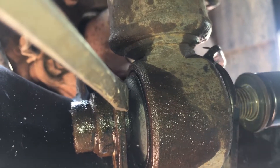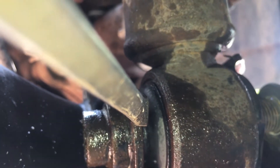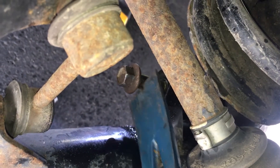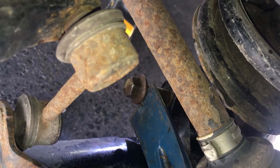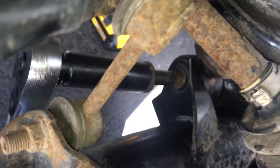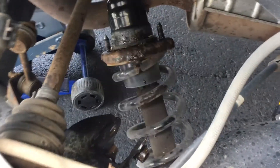Only try cutting this if you're unable to remove the screw in a normal fashion. As you can see on this side, I'm actually able to spin the screw around, so that's what I'm going to keep doing. Once the screw is no longer threaded into the nut, you're going to use a pry bar to move it as far as you can through the unthreaded portion of the strut that it runs through. As it gets closer to being completely removed, you may be able to start relying on the threads to remove it the rest of the way. Once we finally got the screw out, the strut will sort of hang loose and we can just drop it down.